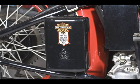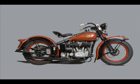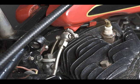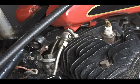This toolbox is used only in 1935 and 1936 on the VL. It's in the correct black enamel finish with the patent decal. No deductions. The fuel tank is in good condition. The gas taps and gas line are flat nickel plated. No deductions.